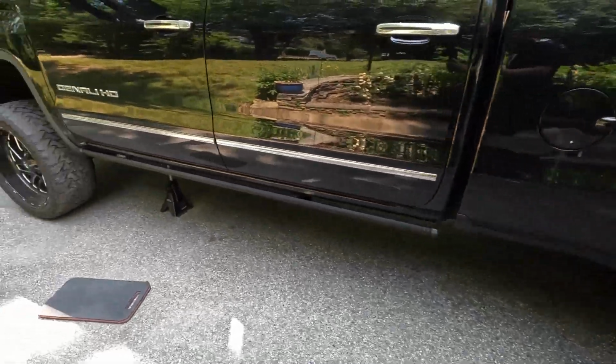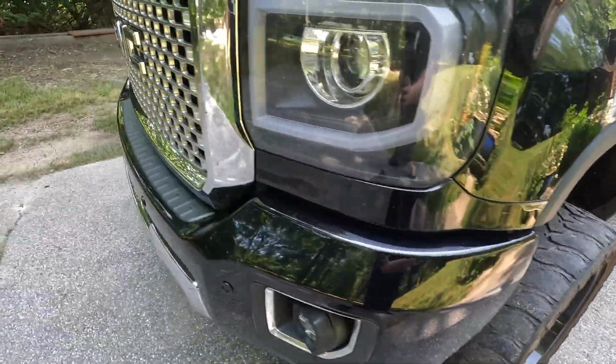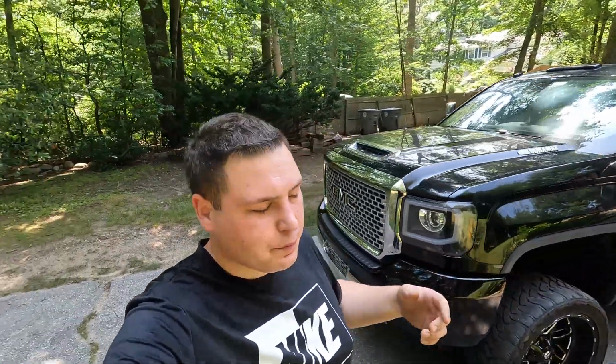And then if you come up to the front here, you can see that these ones are pretty much worn right down. They have some tread in the middle, but not on the sides. And I've played around with all kinds of different tire pressures with these things to try to get them to wear evenly. We had it aligned when we first did it, and they just seem to wear out in the front more, which makes sense. Most of the weight is usually in the front when we're driving without a trailer.